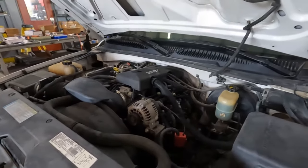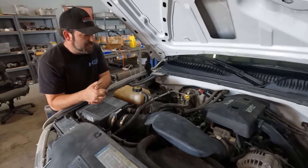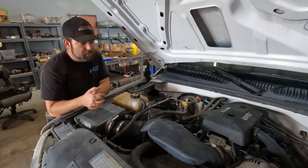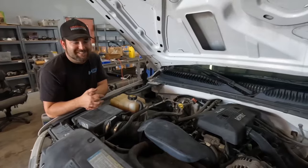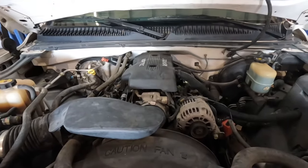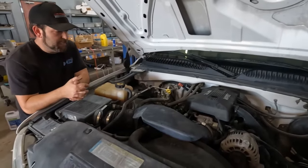Picked this up from my friend Justin for cheap. We are going to do what, Mr. Spiva? We are going to slap in a 7875, probably a 0.81, and see what is the minimum we can do to hopefully make somewhere between 400 and 500 horsepower. That sounds like so much fun. We're going to do this with an FP cast log manifold, either some Deka truck injectors or some Deka 60s, depending on what we got laying around, and likely see where this factory fuel pump gets us. If not, then we'll sneak something a little bit bigger in there.